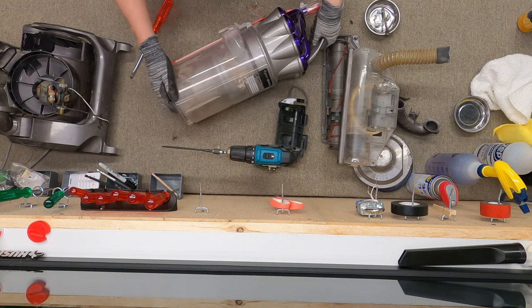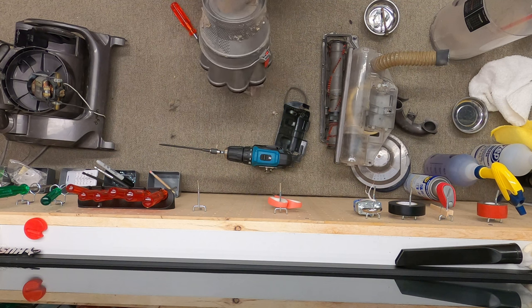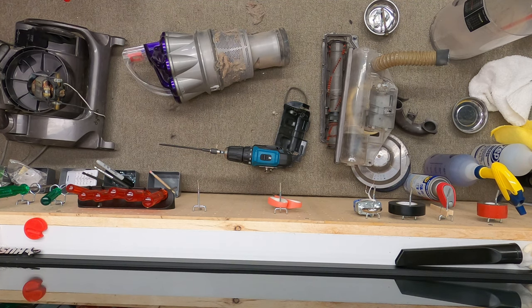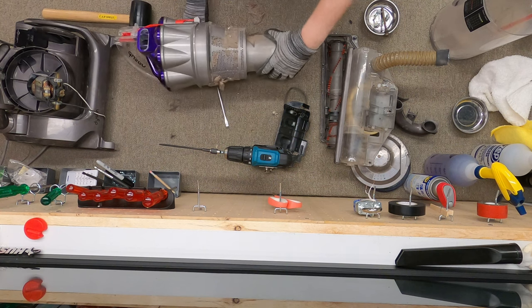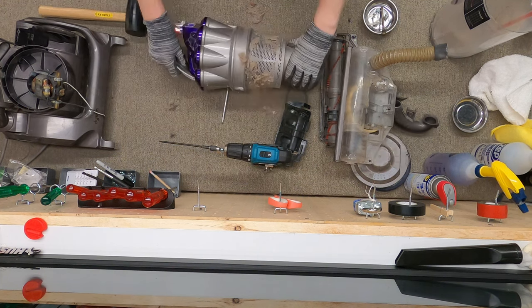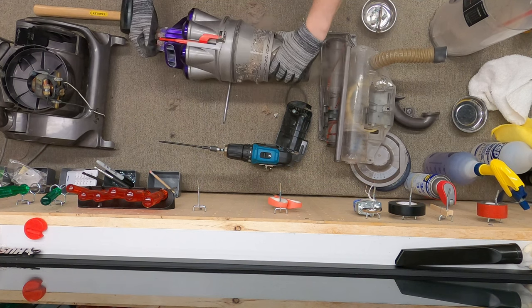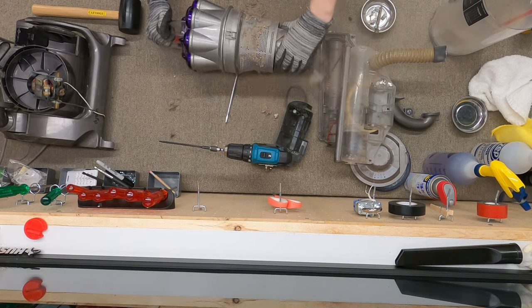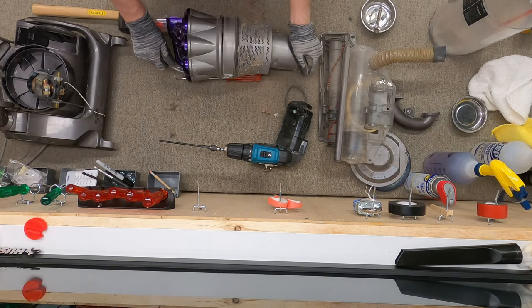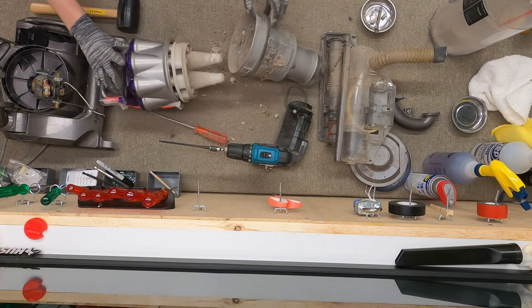This is really really nasty. We have now emptied the cyclone outside — you can see it's still filthy, there's a ton of stuff in here. Now comes the tricky part. The service procedure: you want to put a screwdriver or something down and just hit it, because there's a silicone gasket seal you're going to break. See how this is starting to come loose. There you go — that is how that comes loose.